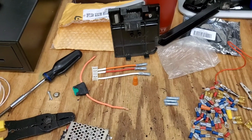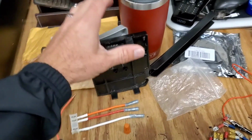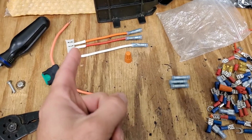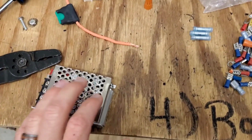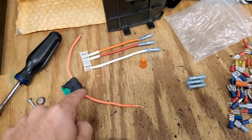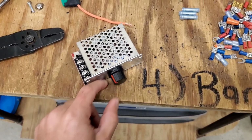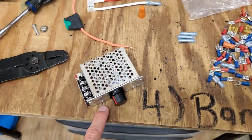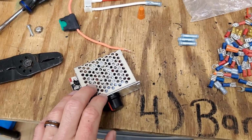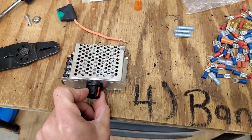Okay, so a lot of craziness going on here, but we got the new plunger on the pedal. So we got the new pedal switches working. It came with a new little harness piece. I'm adding a voltage controller and a fuse. This is just for safety, and this one I want to add in case I want to turn it down for younger kids or any of Joel's friends. And also we're going to be upgrading the battery later, and I just want to have it in there so that when we upgrade the batteries, we don't run it on full voltage and burn the motors up.